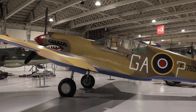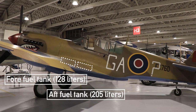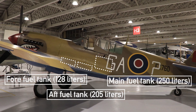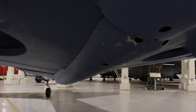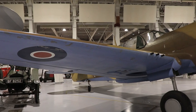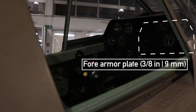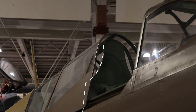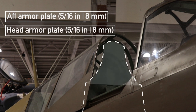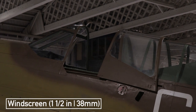In this aircraft the pilot sits on top of two fuel tanks. The forward fuel tank holds 34 gallons and the aft 54 gallons. An additional fuel tank in the fuselage holds 66 gallons. Optional drop tanks of 75 or 150 gallons could be mounted centerline below the pilot or outboard of the gear for long-range ferry missions. The pilot is protected by a 3/8-inch armor plate in front of his instruments and a 5/16-inch armor plate behind him. Head armor was sometimes augmented by an additional 5/16-inch plate, and quarter-inch deflector plates to the sides of his seat also increased his protection. The armored windscreen is one and a half inches thick.